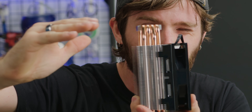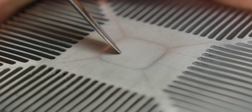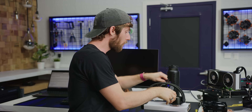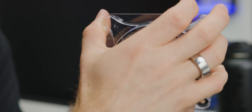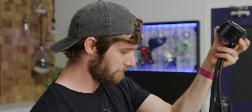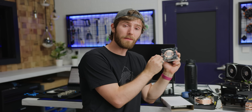For the best possible performance, every heat sink or water block is finished with a smooth, flat surface to ensure as much contact area as possible. Any small imperfection in this surface could easily impact the cooler's performance or even cause the system to thermal throttle. That's why many manufacturers of cooling solutions include plastic covers or at the very least stickers to prevent this sensitive area from being damaged in shipping or by the technician building your computer. Some will have a hard plastic shell — this is particularly common on coolers with pre-applied thermal compound, like this water cooler from NZXT. Because it's so bulky, it would be pretty hard to accidentally install the cooler unless you've removed it — though I'm pretty sure that has been done.